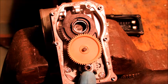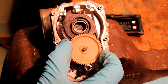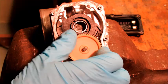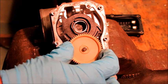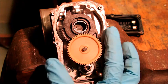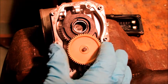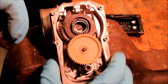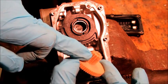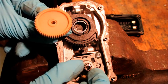So you push the gas pedal, this little gear turns depending on how hard you push it, spins this beige gear, and below that — below the beige gear — turns this black one which is directly connected to the butterfly. There's an idea of how it works. The gears just slide right off. This lower portion of the beige gear was driving the black one, and the upper, larger gear was being driven directly by the motor.